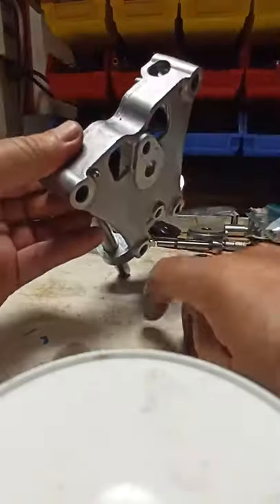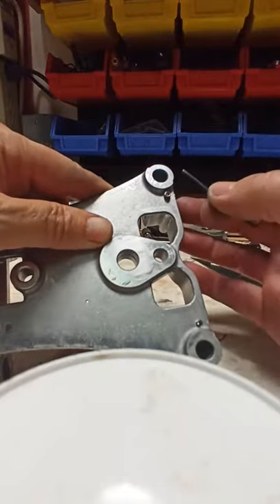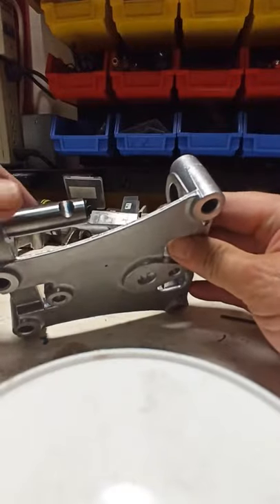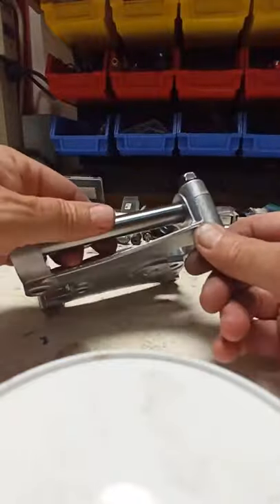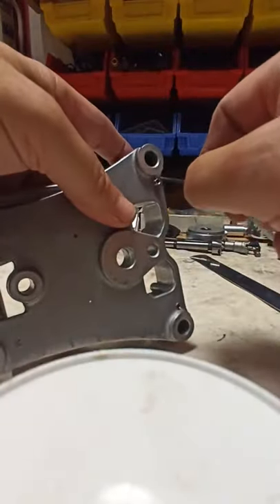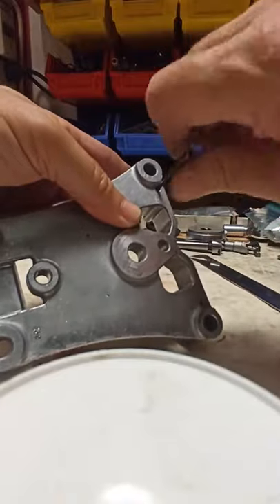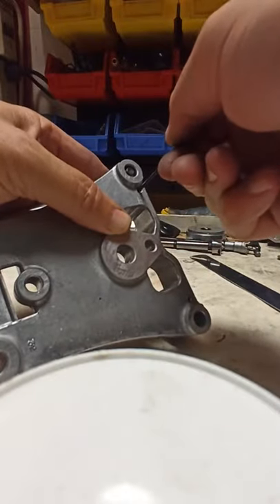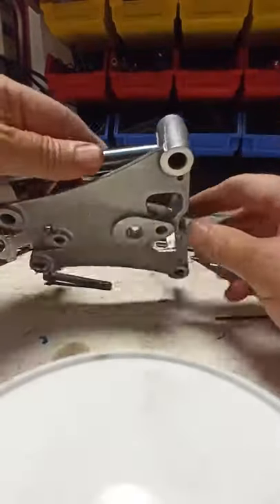It's a safety factor. As long as you use a long Allen screw, there's no chance it's ever going to come out and get into the motor and cause damage. So when I put this assembly together — and you've got that looseness — I'd put a little bit of blue thread lock on this set screw, run it in, and snug it down. And voila, this pin is going nowhere — it's completely held in place now by that set screw.